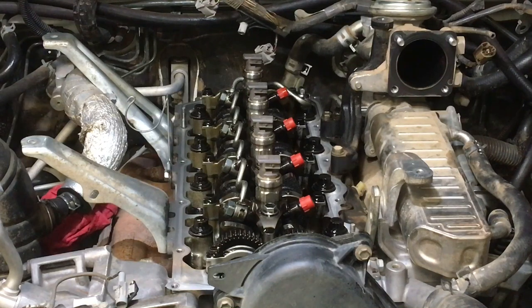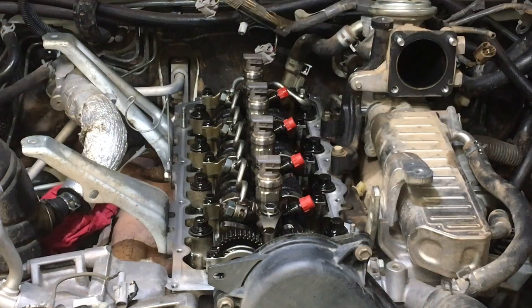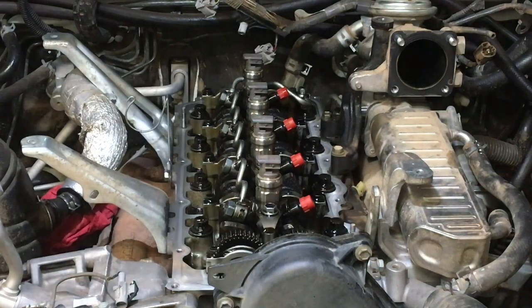So basically, we've got the pipes off and cleaned as well as we possibly can. We've got those special screw-on caps on the injectors. That's what we like to use if we're reusing injectors, not the push-pull ones, which can leave a bit of plastic residue. We're not touching the clamps, and we're not checking any torque specifications on the most important parts of the job, because he doesn't want to do that. I think it's crazy. You're 80, 90% of the way there.